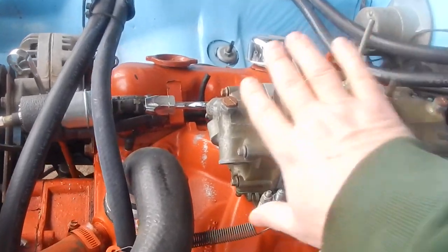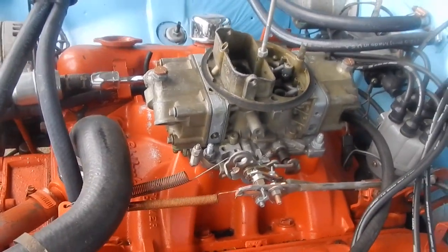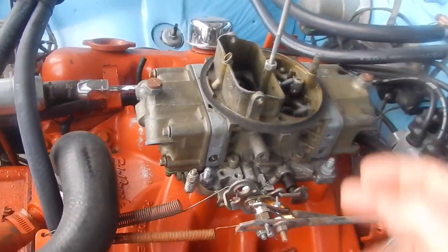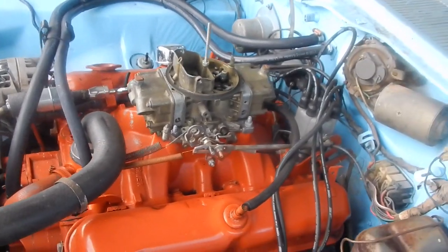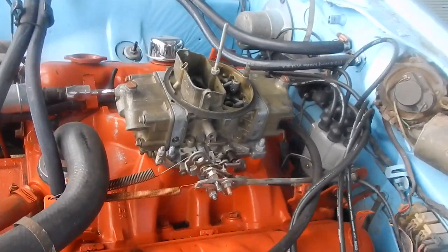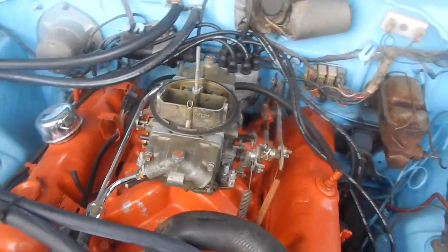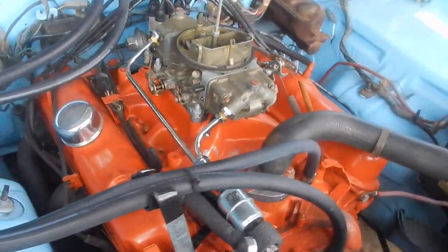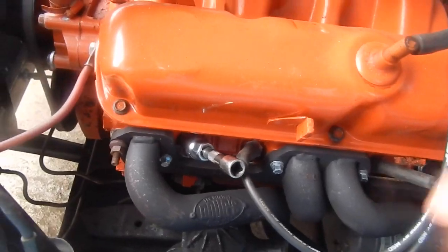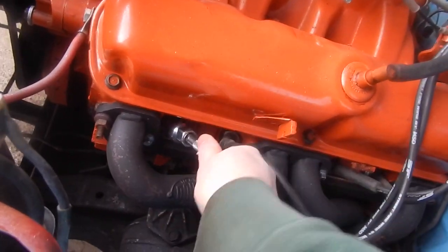So technically the front of this is like a vacuum secondary. The only time the double pumper makes a difference is if you floor it and get your mechanical secondaries open with a shot of fuel. So really, that's another myth, that double pumpers aren't as good on gas as vacuum secondaries. It's another myth that's out there that people just keep requoting and requoting, without any truth to it. Okay, what I'm doing here is most people are going to think this thing is running pig rich, right?